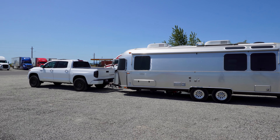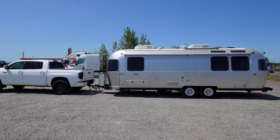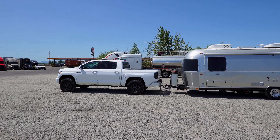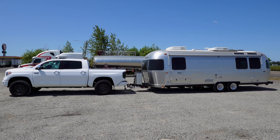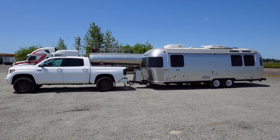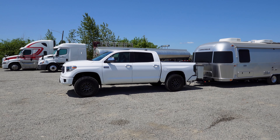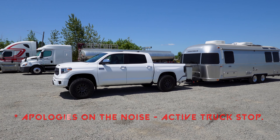I'm actually at a truck stop — I'm at a CAT scale. I'm going to run through and make sure my hitch is doing what it should be doing, which is putting a little bit more weight on the front end, and it obviously is doing a pretty okay job of that. We're not doing pop-a-wheelies too bad over here. It's about 7,600 pounds, give or take.